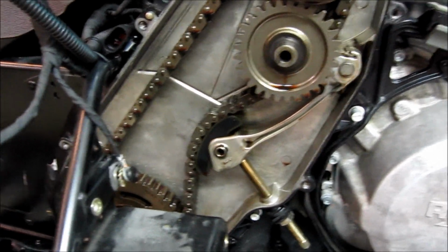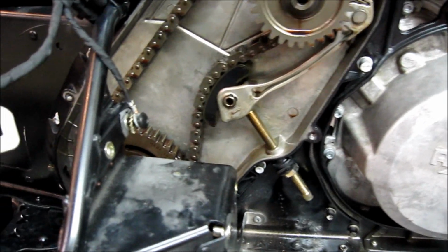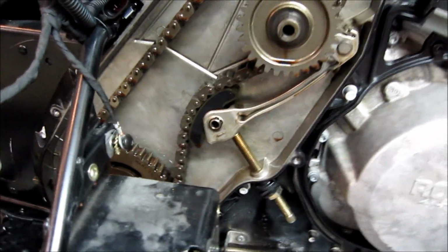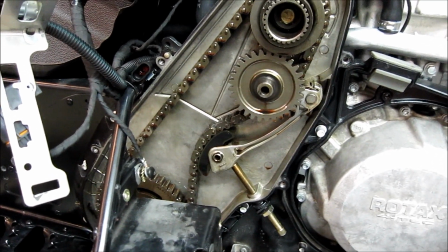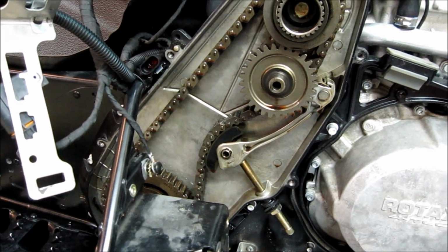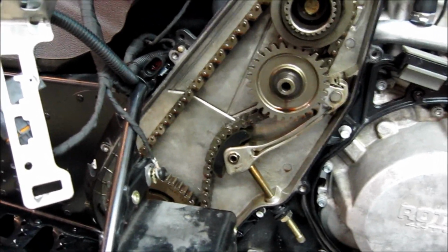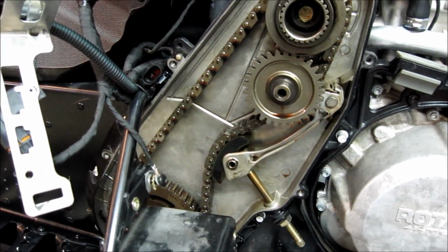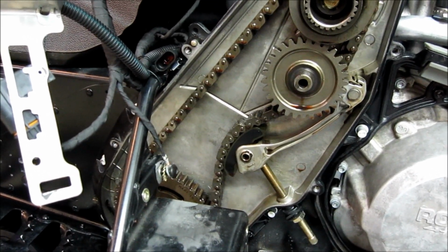And it's really been trouble-free, and I don't see any reason why most of the rest of them shouldn't be the same. I don't like to run the full 500 milliliters of oil because I run a lot of high-speed running. If you don't, you're fine with the 500 milliliters. If not, just take 100 off. Run the 375 to 400, which is what I run, and I have no trouble with it. It doesn't jump out of gear, no issues.